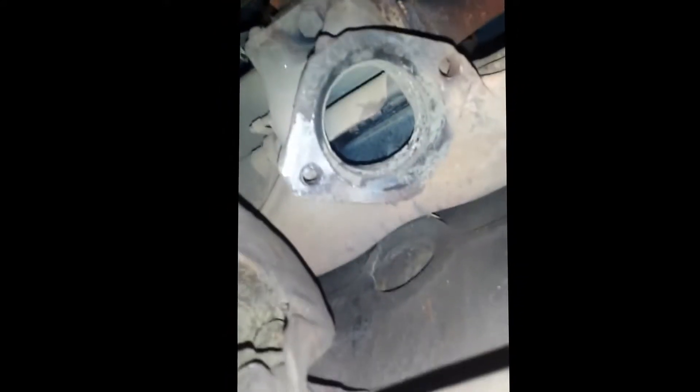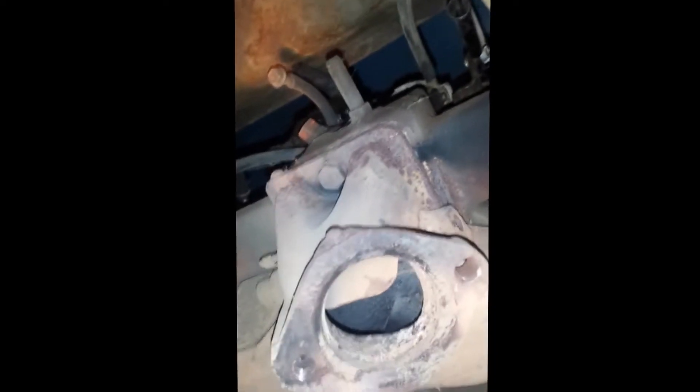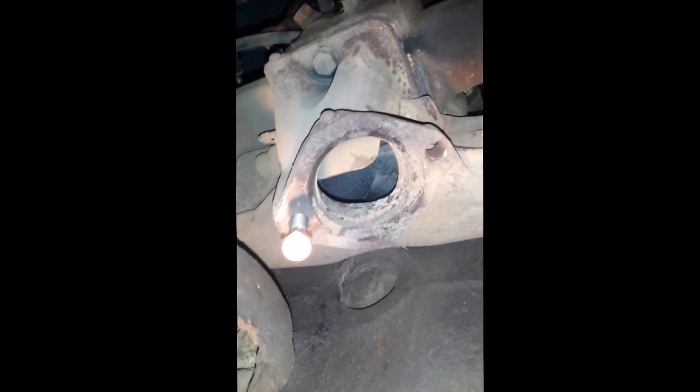Something's turning. Well, after welding four nuts on I couldn't get the bolt out. I decided last resort was to drill it out and actually try and tap it, and amazingly enough I think it's even got some threads in there — it's not great, but let's see. I got a bolt here; I'll have to get a shorter one. Oh, look at that — it's in there! Once again, a shorter bolt. That's amazing that it worked. See you later.